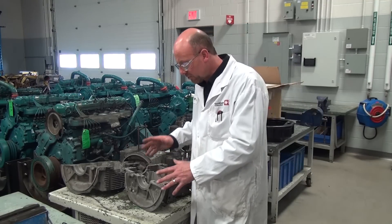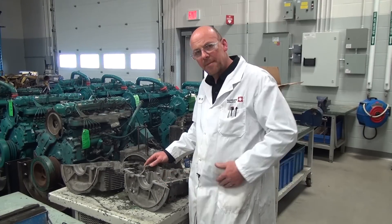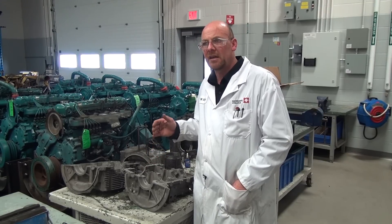Taking a look at this, it's around a 1973 VW Beetle engine. It's a Type 1 engine case and it's a magnesium alloy case. One of the things we have to do is take a look at that pressure relief and regulating valve.